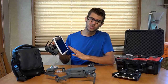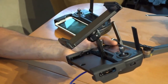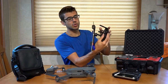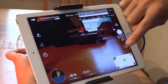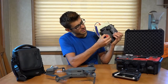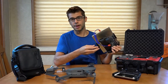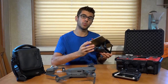Personally, I like to fly on a much larger screen, so I use an iPad with an adapter that slides into the phone position and raises the iPad up. The only drawback is that I cannot easily see the screen on the controller itself, but in the DJI Go 4 app you still get all the same information. The controller connects to another device via a full-size USB port on the bottom, and we use a coiled USB cable to plug the iPad directly into it. It connects to the DJI Go app just like using a phone, and it really works well.